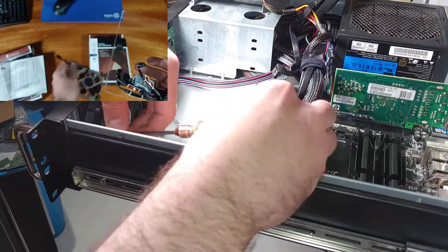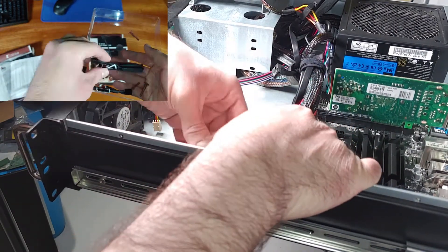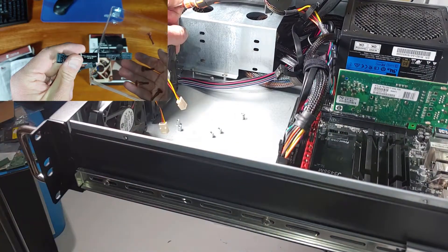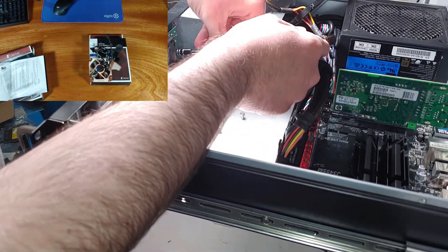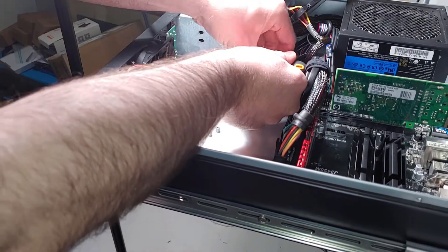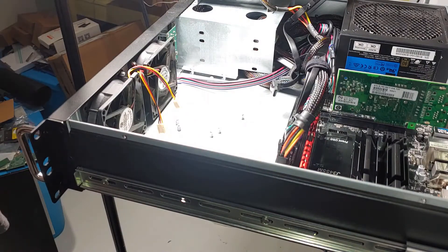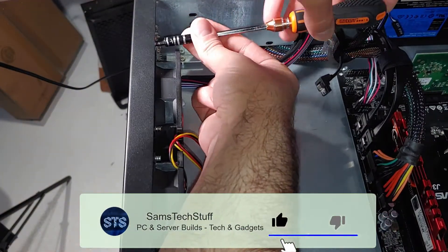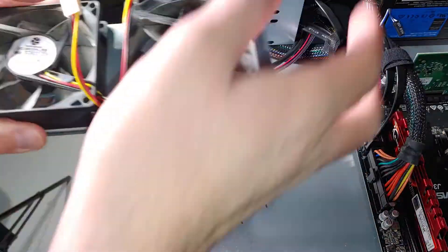The ambient temperature is somewhere between 60 to 70 degrees, so that 10-15 degrees is going to become quite a bit more during the summer months. The heatsink on this CPU-motherboard combo is passive, so all of the airflow in the case actually depends on the front intake fans. That explains why the temperature increased so much. The NF-A8 flex fans that I'm installing today run the Noctua SSO-2 bearing type.